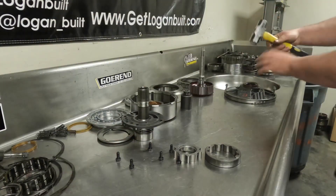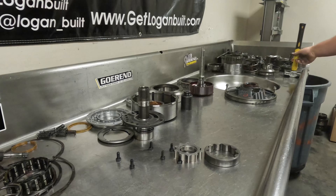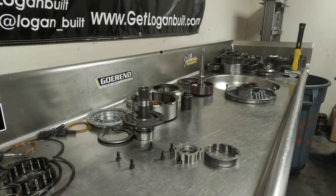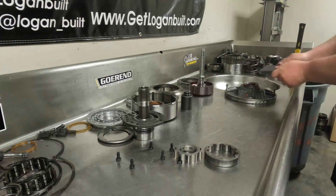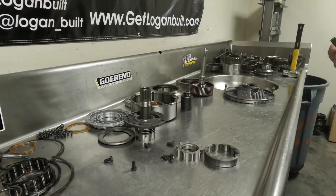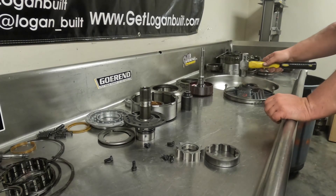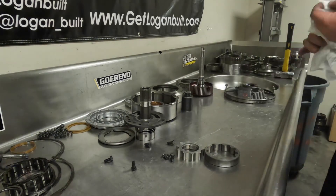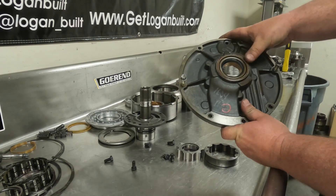The quickest and easiest way I've found to seat the seal is to take a plate from your press — in my case a half-inch piece of steel — and just press it straight down. Just like that it's seated all the way in, nice and square. Now just for good measure I'll lightly go around the outer rim of it with the hammer just to make sure we seal up that Loctite really good. Then clean it off and now we have a really nice pump seal.